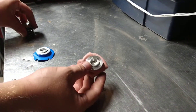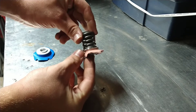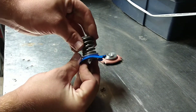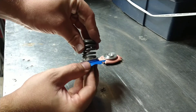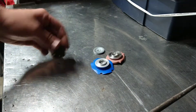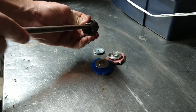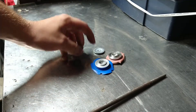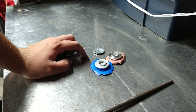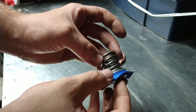This is the old one with the spring — it sits on there nice and tight, flush. This is the Aeromotive one; it doesn't quite sit in there right, there's a little bit of a gap. So I'm going to do the right thing and literally just take a file and massage this open a little bit until it sits on there properly.